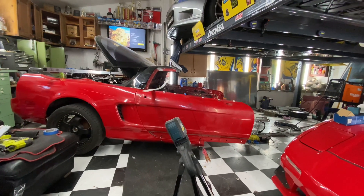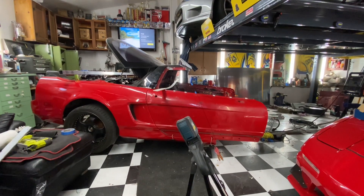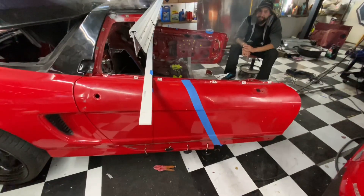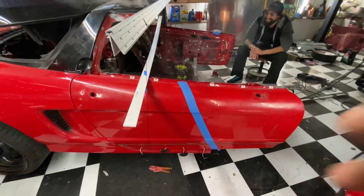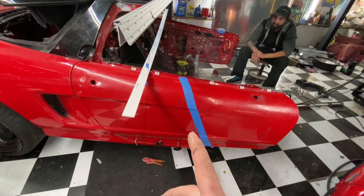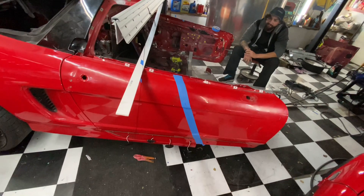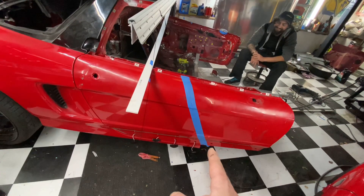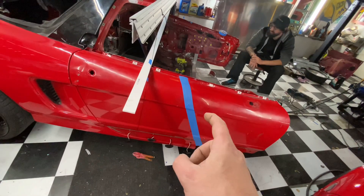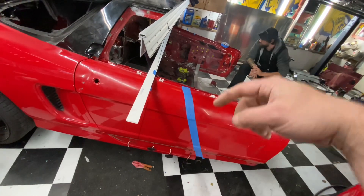We moved the trailer back so we could stop getting concussions from hitting the car lift with our heads. Eddie's finishing taping it up and then I'm cutting. I'm going to use my seven-inch cutoff wheel. I want my cut to end up on the inside of the tape, but I'm cutting on the outside just to give myself a little extra room — I can always do a second cut or grind it down. I don't think it'll make it through both the skin and the door skeleton in one pass, so I'll cut one side and then the other side the same way.